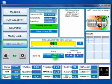So here we have the status, so closed loop. So the vehicle is changing the carburation in this way, but there are some conditions, for example high acceleration or cutoff, where you see that we go in open loop condition. In open loop condition, the car doesn't change petrol injection time with a feedback from lambda and so on, but the petrol ECU is running with pre-mapping. And so now we switch on gas.